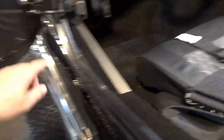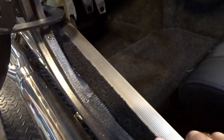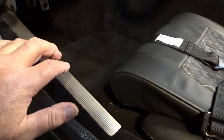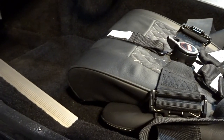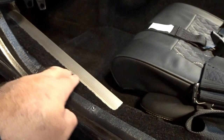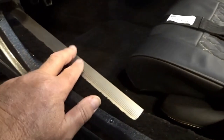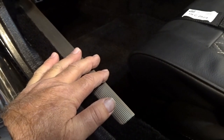A little variation on what we did on the last car. I pulled some bulk carpeting out from upstairs. I ditched the Factory Five pre-cut pieces for this whole area right here, so I have one piece that is on the bottom of each of the three sections and it wraps under. Before I pop-riveted this piece in, I glued the tail that had gone over the edge and onto the bottom, then pop-riveted the piece in with about a dozen or so pop rivets. Then I wrapped the carpet over - now it's glued down tight. I went ahead and added this piece of edge trim to protect this edge during entry and exit from the car. So these are all done.